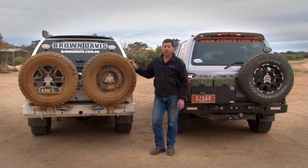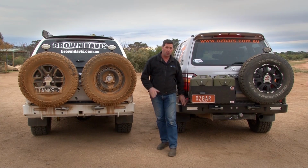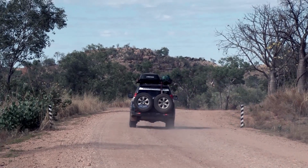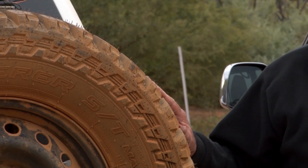A very short answer to your question is that on your standard rear bar, no, you can't. Standard rear bars on most modern vehicles are plastic, with a small steel reinforcement section in the back of them, just to fill up gaps in the bodywork that are left by manufacturers, basically. The strongest, safest possible way of carrying 2 spare wheels is on a replacement steel bar.